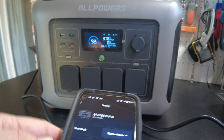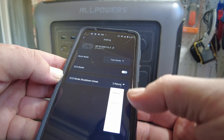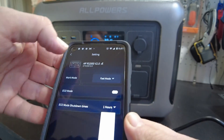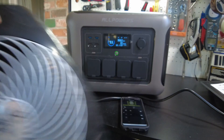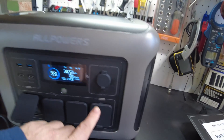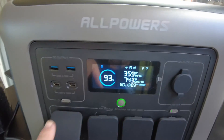In the app we're at standard mode, fast mode, and I'm not sure what eco mode is — maybe that's where the inverter shuts down after a period of time. We've got one, two, four, and six hour timer options. Let's plug in a load while we're charging. We'll plug in this heater, turn the AC output on — and yes, we can charge and use the AC output at the same time.